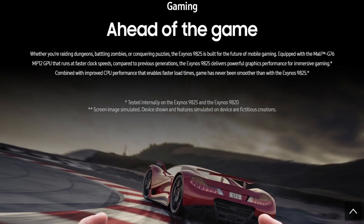They haven't upped the clock frequency of the Mongoose cores because those Mongoose cores really are battery hogs — they do eat away at the battery. So what they've chosen to do is tweak those middle cores, the Cortex-A75, with the hope that when you start doing tasks that need more than the Cortex-A55, they migrate up onto the Cortex-A75. That extra clock frequency will mean they'll go a bit longer before you have to call in the Mongoose cores and really start hammering the battery. Likewise, the 9825 has the same GPU as the 9820 — the ARM Mali-G76 MP12 — but again, they've upped the clock frequency of the GPU core ever so slightly, though no specifics are yet available from Samsung.